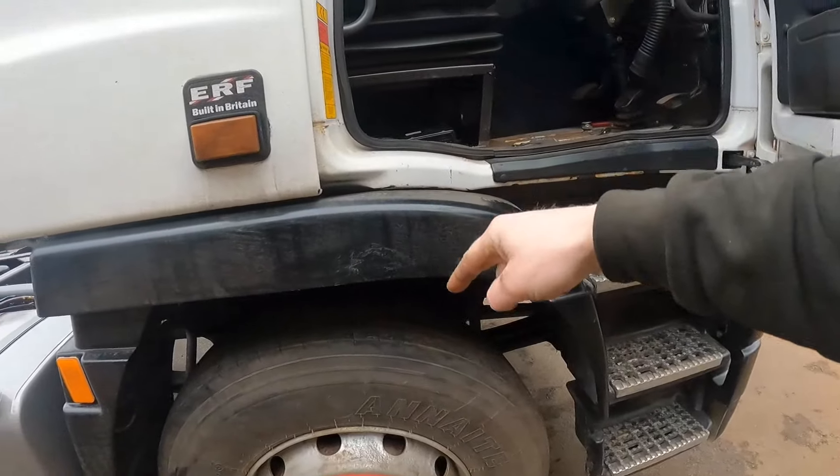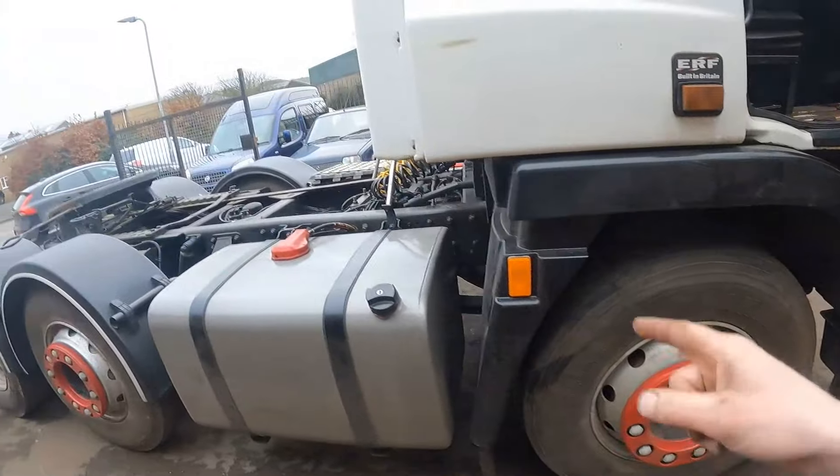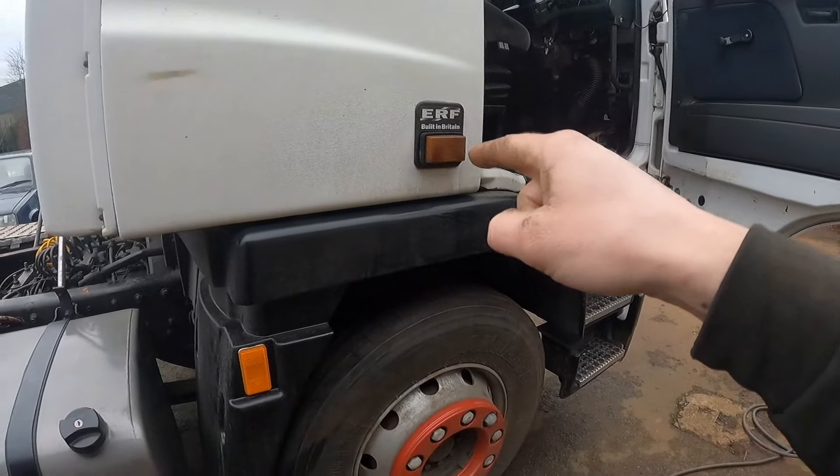I've been making some progress with the ABS. It's got flash codes but the light's still not going off. I got Dad to turn the ignition on - you can hear two ticks from the new ABS module. I lay underneath while Dad turned the ignition on and it's the actuators ticking in the order they should go: driver's front, passenger rear, passenger front, driver's rear. But I'm only getting two ticks on the front and nothing on the back end. I need to figure out why there's nothing happening at the rear.